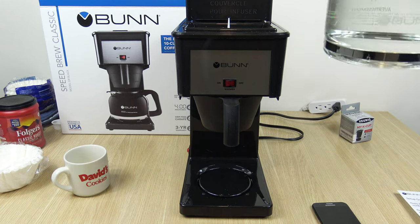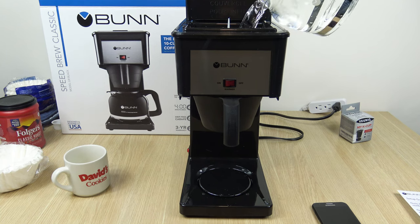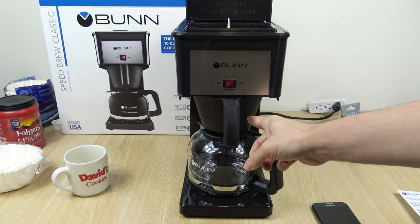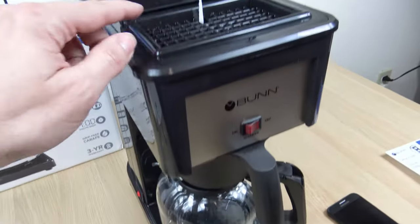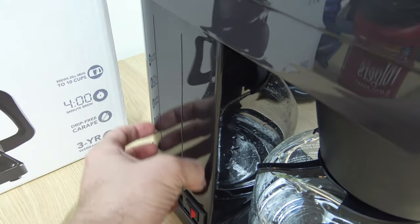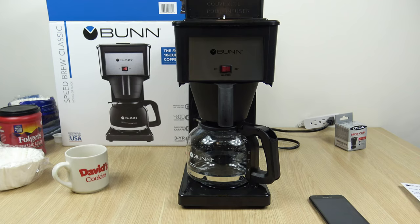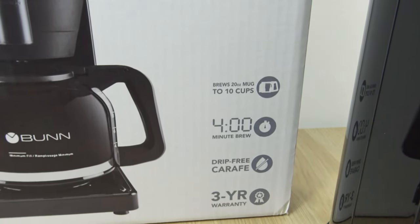I'm going to explain how this is going to work. First, we're going to pour in 10 cups of cold water. Very important: before you close that lid, make sure the carafe is underneath the funnel and ready to go, because the minute you close this, it's going to start brewing. Remember when I said that's sort of like your on-off switch? When you close this lid, it's going to push that down. The lever is going to release the cold water into the tank — that's going to replace the hot water and force the hot water up to brew into your coffee pot. It claims to be the fastest 10-cup home coffee maker and is supposed to take around 4 minutes to brew, so we're going to time that.